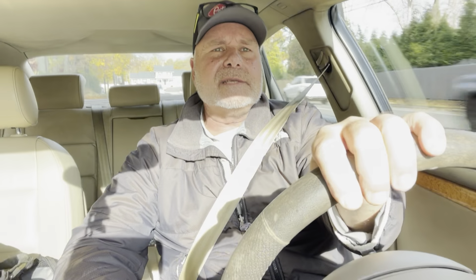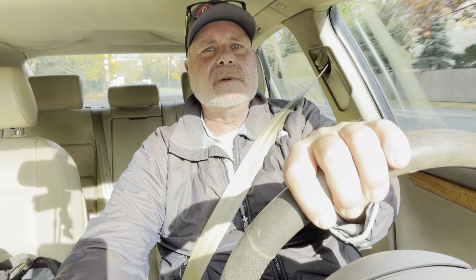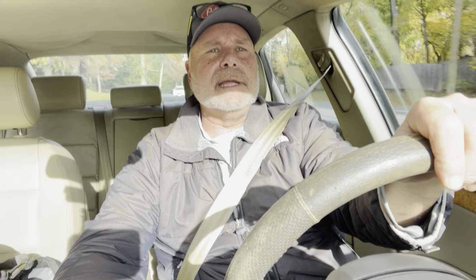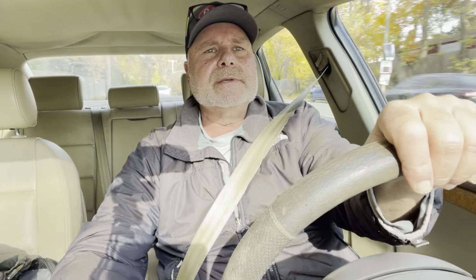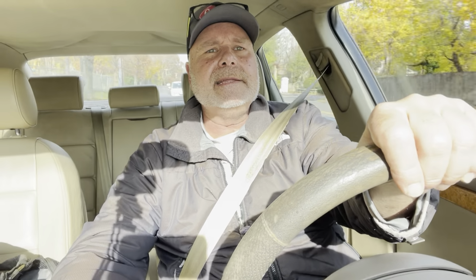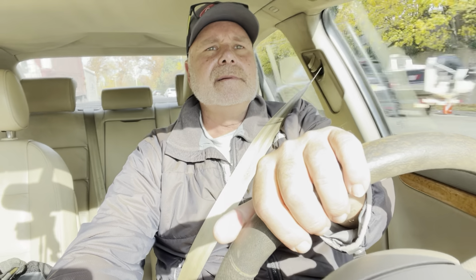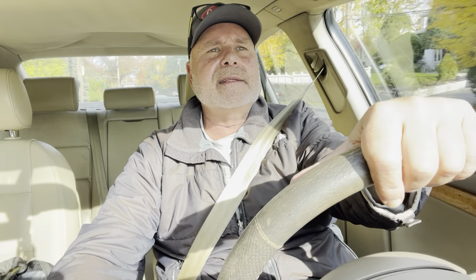I'm hearing that winter is coming next week to the northeast and the central part of the country. Snowstorms. Back to back, the 23rd, and they're saying the 26th and 27th, another one. So don't forget to bleed your air tanks. Protect yourself. Be smart. Anti-gel. Let's go. Wake up. Bleed the tanks. If you don't do it daily, you should do it at least every other day. I know we all forget to do it, but it's a friendly reminder. You get moisture in those lines, stuff freezes at night.